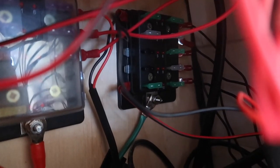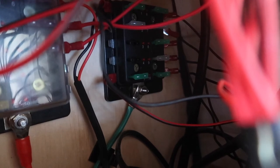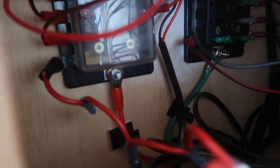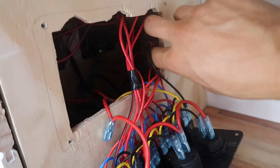Behind the panel we have a whole series of wires. At the back we have two fuse boards — one for negative and one for positive. The negative one I've put in heavy fuses to work as connections; I didn't want to fuse the negative. The positive is actually fused correctly for each appliance, and each of the wires feed into that and tether down on a 30-amp cable into the Anderson plug connector on top of the box. It's all very clean.